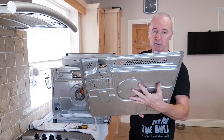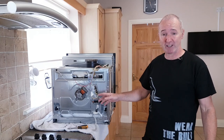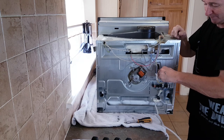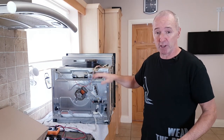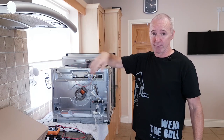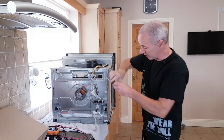All six screws are out. The backplate lifts back a little and then pulls up — there are two tabs on the bottom that go into two little holes, so that's it, easy. Now the element for the fan assist is here — there are two terminals on it and I'm just going to disconnect the wires. It's AC so it doesn't matter which is top and which is bottom. Be a bit careful because the sheet metal can leave sharp edges and you could cut your fingers.